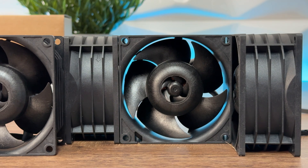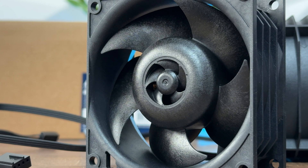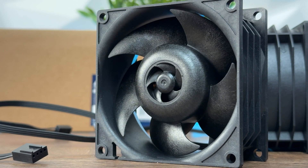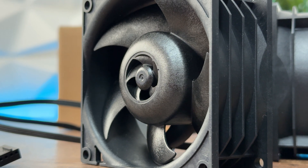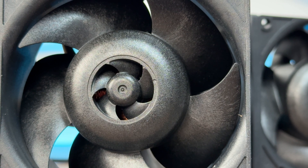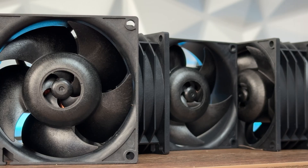The impeller of the S8038 10K is held in place by two ball bearings, which means it's not only durable but also less sensitive to external influences such as heat and dust. In server rooms dust definitely tends to happen. The S8038 10K has a wide speed range that can be regulated with PWM and voltage, allowing you to tune the fan specifically to your needs — from 500 RPMs up to 10,000 RPMs — providing an ideal balance between cooling performance and noise.